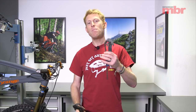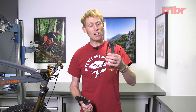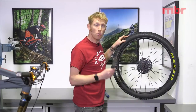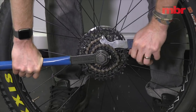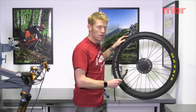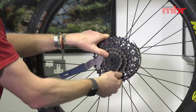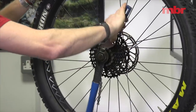This is actually my personal one and I've been using it as a chain whip for about 10 years, so it's looking a little bit worse for wear, but it does the job. The chain whip's job is simply to hold the cassette in place to allow you to loosen it using the cassette tool. With this, it's a simple case of just wrapping it around the cassette and then you can loosen it exactly the same as you would normally.